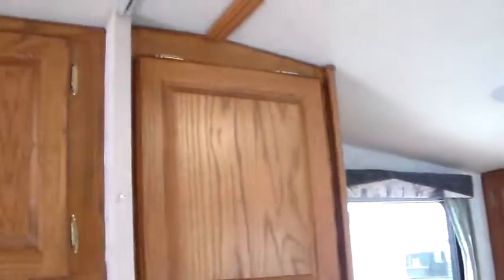I'll give you an overall view first and then we'll go through and I'll show you some things. Corners — I always want to concentrate on corners; they're going to tell you how much wear you've got on a camper. The corners of these things are in super, super condition for a camper of this age. Window treatments — blinds are all in really good shape, still staying up. It's got the Ozite carpeted ceiling, and going corner to corner there are no stains anywhere, no soft spots in the roof. The roof looked wonderful — absolutely great.